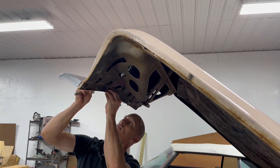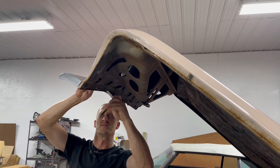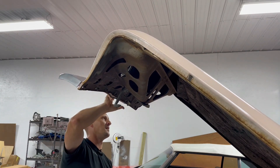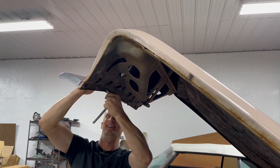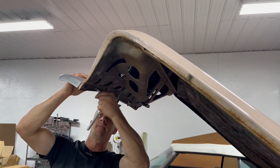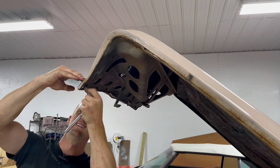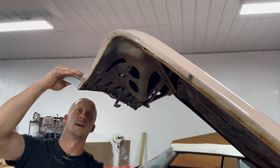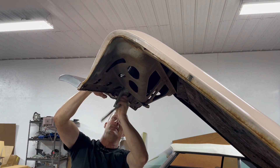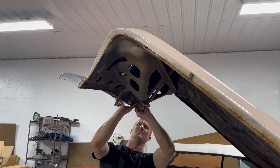One bolt left. This is such fragile stuff - even though it's just really big and bulky, it's really just weak, weak stuff. So always hope that you don't just rip the threads out of these things. You just kind of want to snug them down and don't he-man them on. Yep, see that one's stripped - that's not good. That one is also stripped.